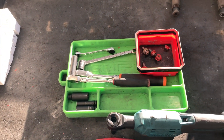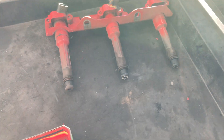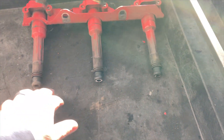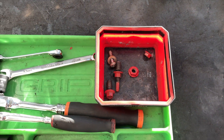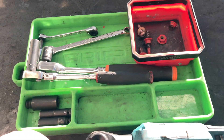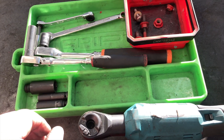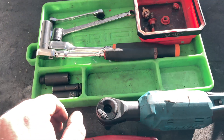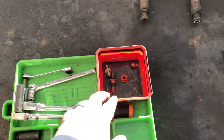Organization is key. Now that you've got three cylinders open — you haven't pulled the plugs yet, but when you do you have three open cylinders — and you've got a lot of little small nuts. So you don't want to drop anything; that would be pretty catastrophic. Keep your tools together, keep your nuts and bolts together, keep your parts nice and organized.